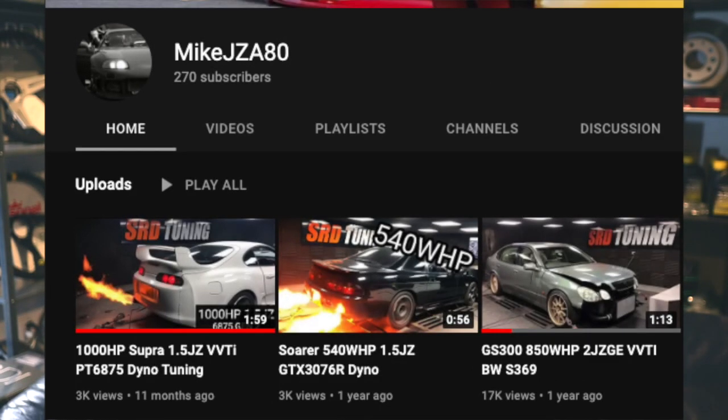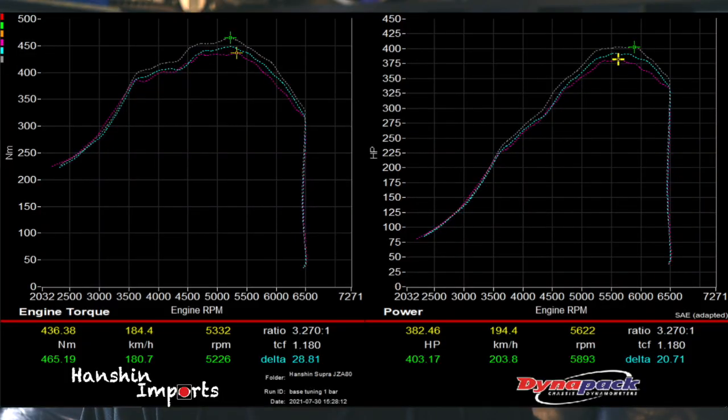We're back in the office — we just tuned the Supra. This car is in for getting road legal, so I just wanted to figure out what sort of power the car can make with a simple retune keeping the stock boost system. The only thing I changed is that I made the twin turbos not work in a sequential form but in a parallel dual form — shout out to Supra Mike for helping me with that. Basically all I did is adjust ignition and fuel, and with stock boost pressures we could go over 400 horsepower.